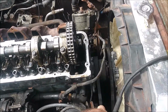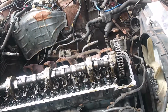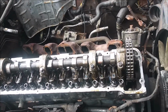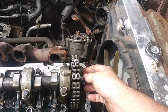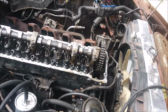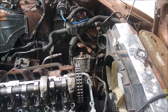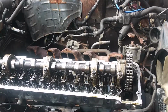First, you want to make sure that the engine itself is at 0 degrees, top dead center, and that these are all pointed right. Have that set down and verified. Then you take this bolt. I used the bolt off of the N42 camshaft because it's in better condition than the one that came on this engine. You torque that down to I think 106 foot-pounds. So, quite a bit.